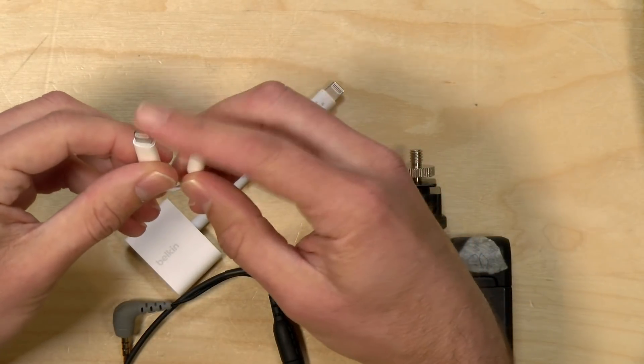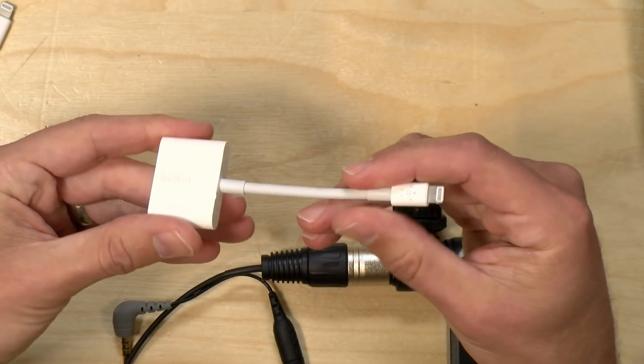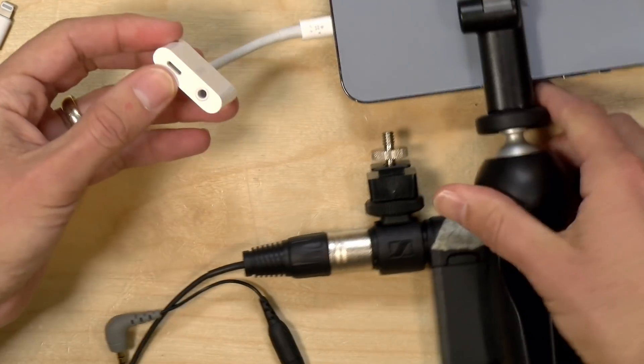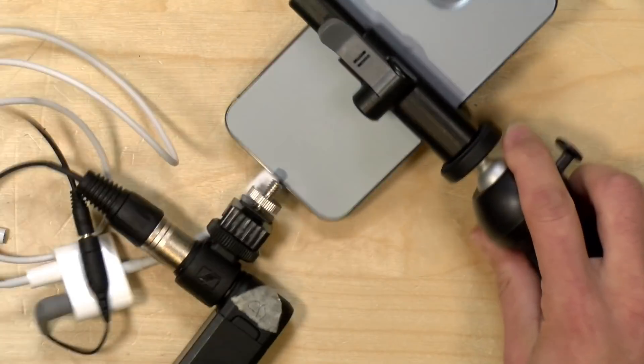As far as adapters go for the lightning connector, you can go with the basic one — a simple 3.5mm to lightning, but you might want to charge the phone while you're out in the field with a battery pack. So this Belkin connector might be the better way to go — you still have your lightning connector exposed here so you can provide power to the phone and get your microphone going in at the same time. Then we can mount this to the Glyph, put our light here on the top, and now I can go out in the field and record video like I would with my normal video camera but with just my phone. Yes, there's more stuff hanging off of it, but it's also a lot less stuff that I have to lug around. I have plugged in my microphone before with all this stuff hooked up — it works, so it's kind of a neat experiment.